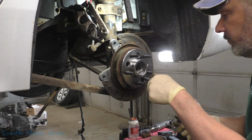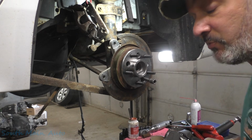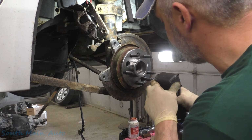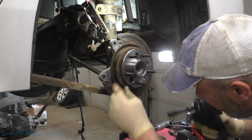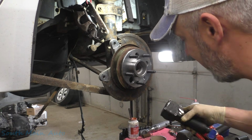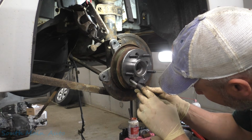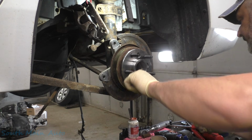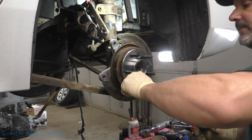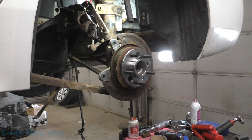Oh, there's a big clue for you. So that's gonna be your classic P0128, which will inhibit the monitors from running. I'm surprised. We still have this in wuss bag mode, so no, I'm not stripping stuff out, calm down. I'm just surprised her light doesn't come on and stay on, to be honest with you. We'll grab a little ratchet. Let me go talk to this lady. Be right back. Stand by.